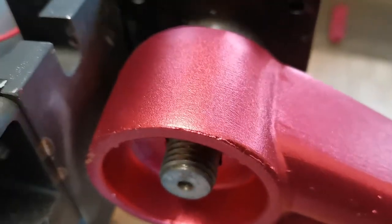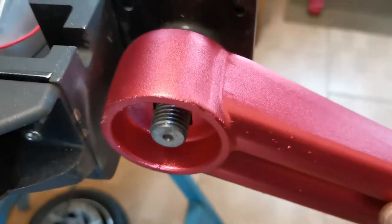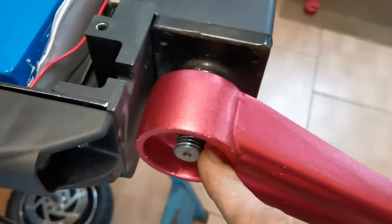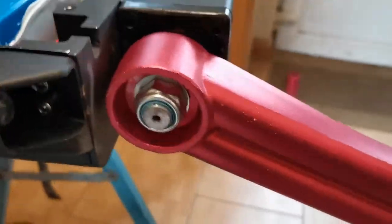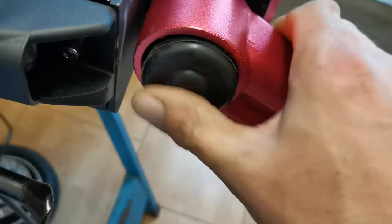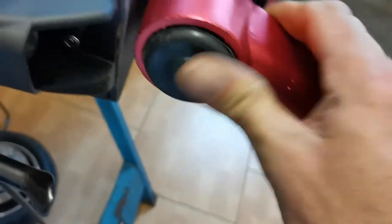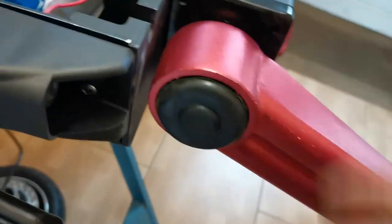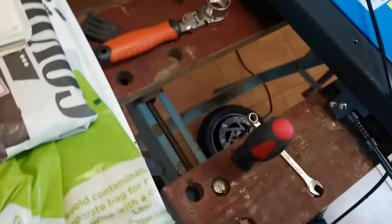Once you've cleaned off all the grime and cleaned out the thread, place the new arm on — no need to bang it into position, the washer and the nut will do that for us. Once you've done the nut up, replace the rubber bung, give it a little twist so you know where it fits over the hex, and press it in with your thumb. If it's not going in with your thumb alone, check the inside of the rubber to make sure it's not clogged, and if needed use a mallet gently — it's all about the mass, not how hard you're hitting it.